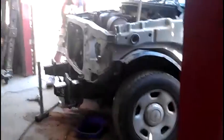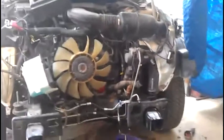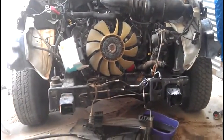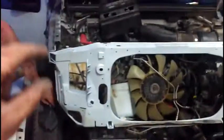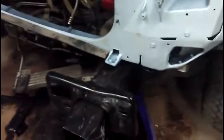We're going to drill them out right now. Got the radiator support off — it was a pain in the ass. There are a few pieces I've got to cut off, and then we'll put the new support on. We got the new radiator support on now. Closing the end up real good so I can do some welding later. As you can see, it looks pretty good — it's kind of rough here; just going to flatten it out, dolly it real nice, and start buttoning it all up.